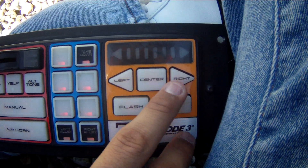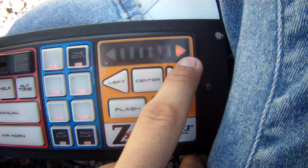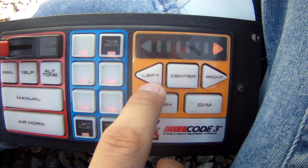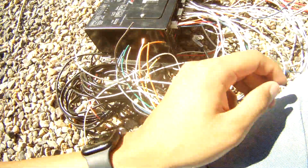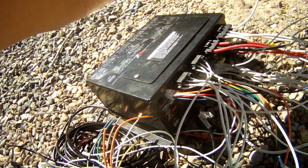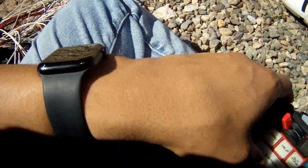These arrows here control the backlight. Hold this all the way to the right and on this little LED, the brightness is fully up. All the way to the left, there's basically no brightness on it. These white wires here are for levels one, two, and three.